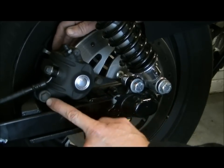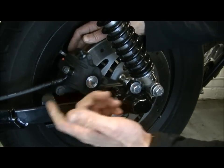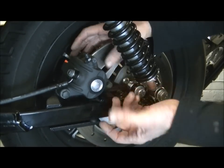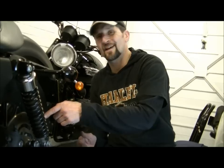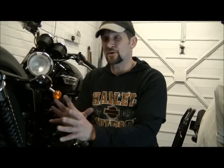A lot of people go taking this bolt out straight away, or they undo it, pull it halfway and it doesn't come, and then they pull this rubber off thinking there's another bolt under there, and they split it, and it's very common. In fact, your Harley parts guy will tell you they probably sell more of those rear boot caliper covers than anything else of that system, purely because people pull them off to see if they can get a bolt there and they split it because it doesn't come off. That's not designed to be touched unless you actually take the wheel out.